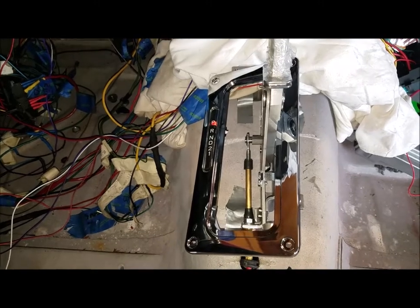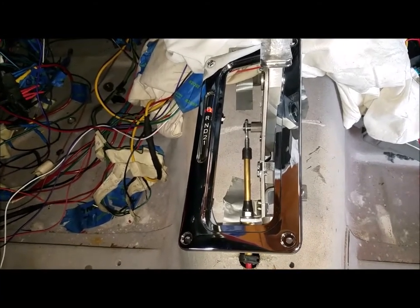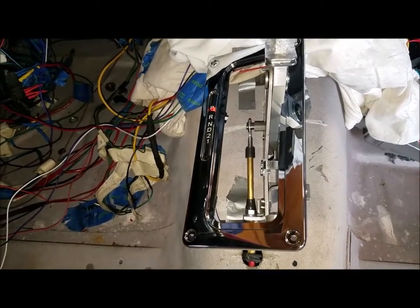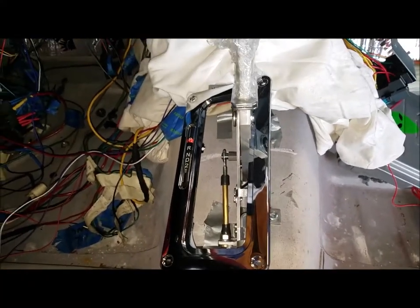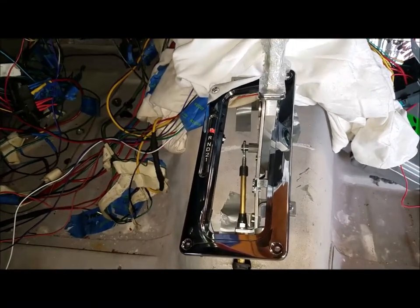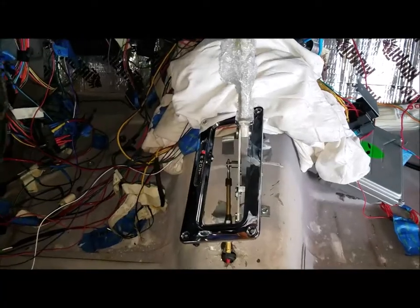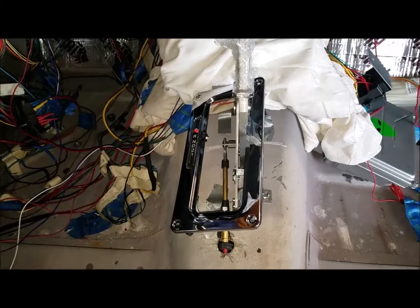Well, that was a big no-go — it still starts in every gear. I really thought the neutral safety switch next to the transmission would take care of that, but obviously I have some wiring to do. This is as far as I'm going to go right now with the B&M shifter because I have a lot of other things to do and I don't want to put stuff on and take it off. It does function as it's supposed to per the manufacturer. I still have to figure out the wiring, so maybe that's the issue. Thanks for watching — I'll give you an update when I figure out the vehicle starting in gear. See you next time.